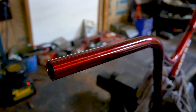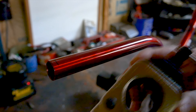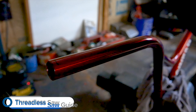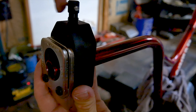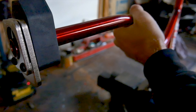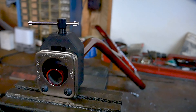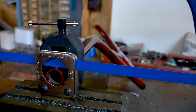It's really not that much, so we probably could get away with not cutting these bars, but for the sake of the video I'm going to show you how to do it. If you're using the saw guide method — which I prefer because of how simple it is and what a great tool it is for getting a clean cut — all you have to do is line up the saw guide with your cut mark and tighten it down. Once we're lined up, take the bars out of the vise, remove the padded magnet parts, and clamp it back down. Once you have your bars marked and your saw guide lined up, take your saw, put it into the guide, and start cutting.